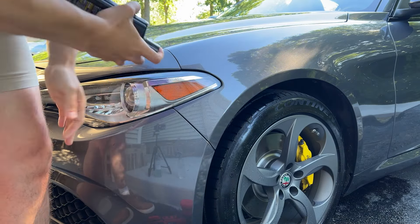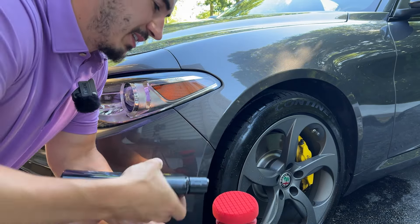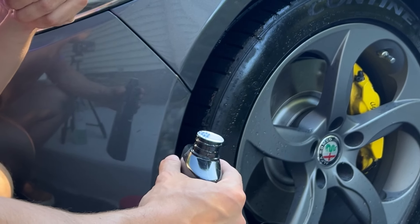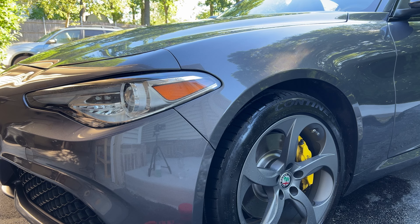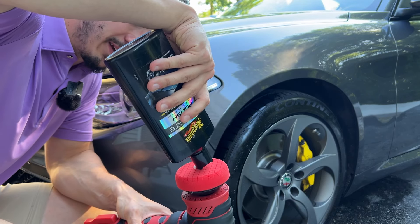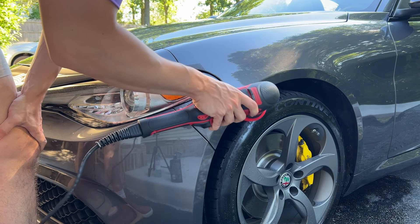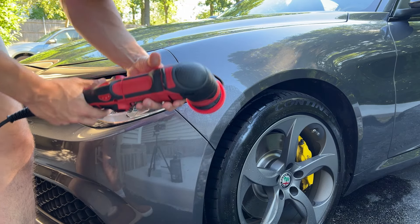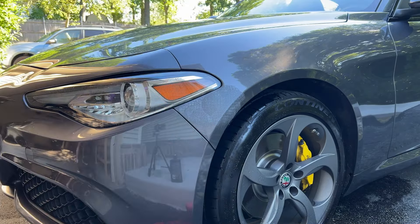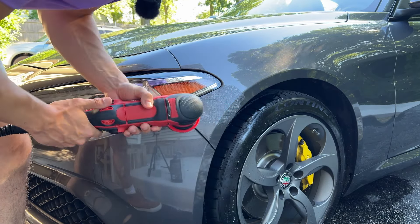Since this is a small area, I'm not going to use a lot of polish. I'm just going to take a little bit and put it on my pad, then dab it around. The reason you dab it around is so that when you start up the polisher, it hopefully doesn't spit the polish everywhere. You probably also want some glasses in case polish flings around. Set your polisher at a lower speed just to get it started, then once it's going you can bring it up to a nice high speed.